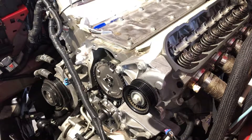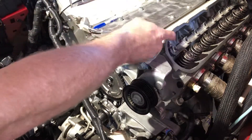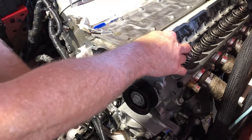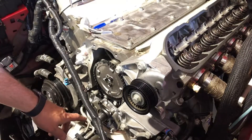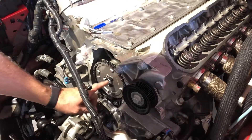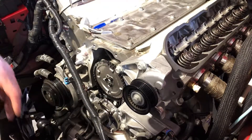So that works great if you have your timing cover off. Now, if you don't have anything off and you needed to find base circle, you could still do it using the crank. You would allow the push rod to come up, and when the push rod peaked, you set your mark right on your crank or even on your ratchet on the actual socket as long as it doesn't come off. But this time you'll rotate the crank one full rotation — one full rotation of the crank is a half rotation of your cam. It'll get it from the tip to the base by doing one full rotation.